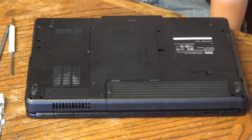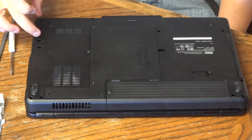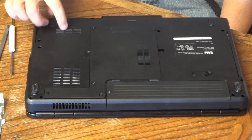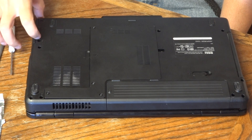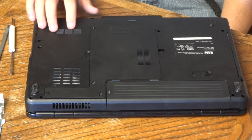There are a couple other things I'll show you that I won't be upgrading today, but if you wanted to, it's real easy. The hard drive right over here on the side — there's two Phillips screws that you take out. This tray then pops out the side, and you'll see the hard drive is attached to the tray with another couple of screws that you'd have to take out to just replace that hard drive. It's real simple.